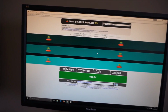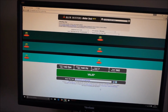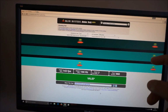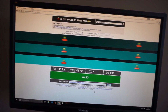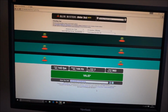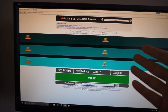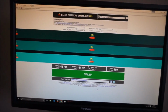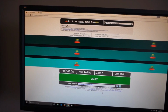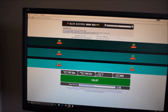There's an article on responsiveness on the website which covers that in a lot more detail, and the written review covers it in a little bit of detail. But you'd also see an element of the pixel responses, and generally on gaming monitors the pixel responsiveness is really good. Very strong overdrive is used to speed them up, but as a consequence you'll see overshoot or inverse ghosting behind objects. And it's not just when you're looking at a little test like this, it's also when you're playing games. And the BenQ XL series with the AMA, Advanced Motion Acceleration, they're notorious for having some real issues with this, which really put some users off.